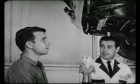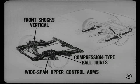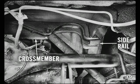Okay, Tech. Now, I notice this suspension system looks different. What's the story? Well, Chrysler and some models of Plymouth and Dodge have a lot of new features for a softer, quieter ride. The new suspension features front shocks that are mounted nearly vertical, new compression-type ball joints, and wide-span upper control arms. There's a new cross member at the rear to mount the shocks.